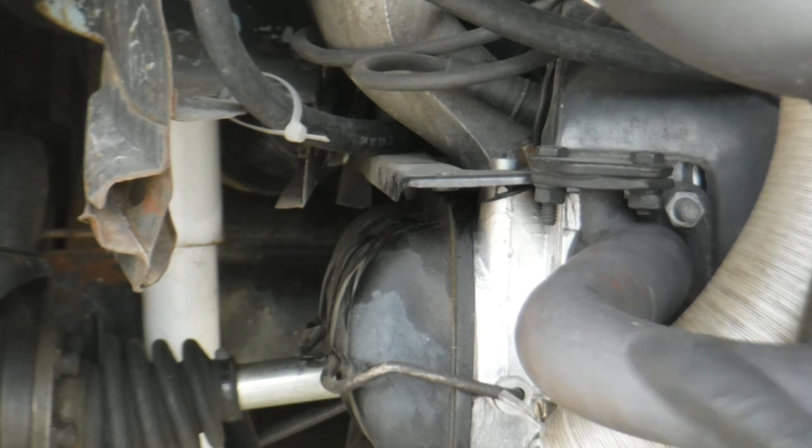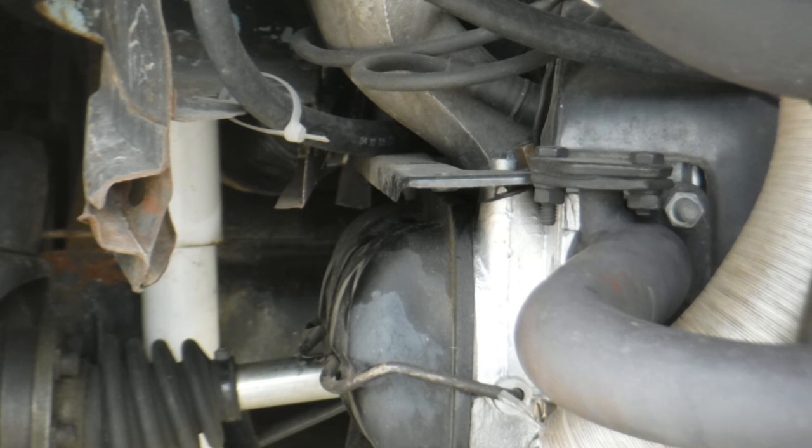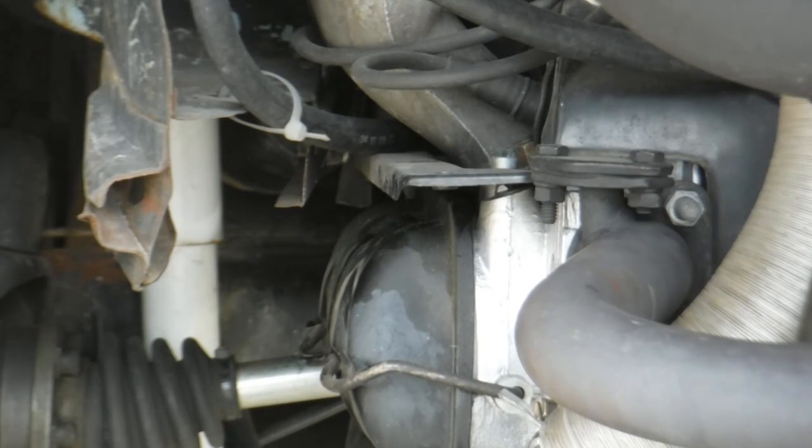That's all it takes to check your valve adjustments - in this case it was quick because we didn't need to adjust. Another point: I'm using heavy duty springs and as an experiment I'm using stock aluminum pushrods. You have to make sure they're the right length - this turned out to be the right length because I have a little space right underneath there. The elephant foot adjusters take up a little space, so normally you'd put shims underneath the rocker arm stands. It's not a stock cam but a very mild one - I believe it's the CB Performance 2239. These are the cheapest Chinese heads I could find and they did the trip just fine.